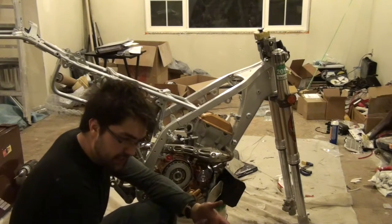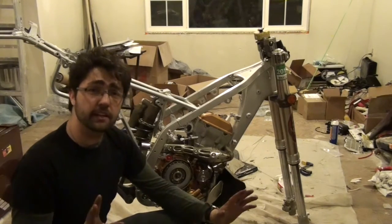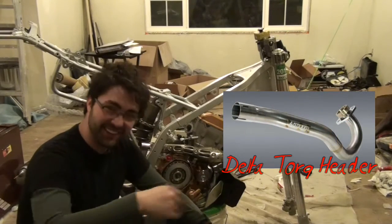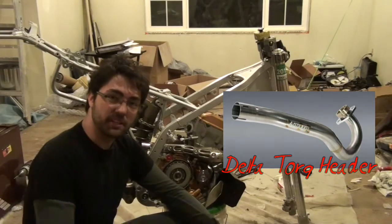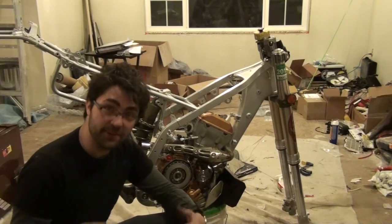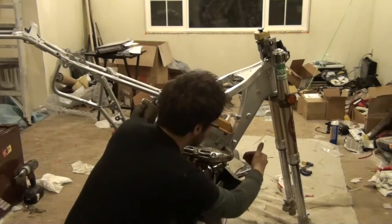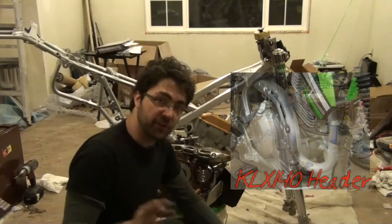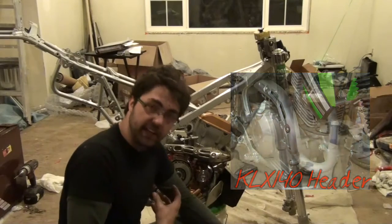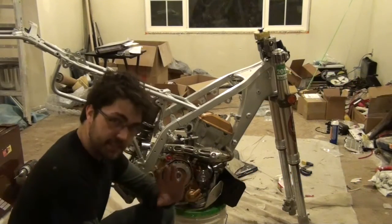There are two companies that I know of that make aftermarket headers worth noting. One is a Japanese company that makes a header with a dip in it. Because the header is very long and has that extra motion in it, it allows it to get a lot more torque at low RPMs. Most dirt bikes, or even the DR as a dual sport, has this dip that comes out in front of the bike to add more length onto the header and give it more friction to keep the exhaust gases in there, so it can suck out that last little bit of exhaust gas once the valves both pop open — maximizing the scavenging effect.